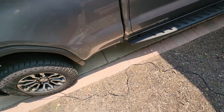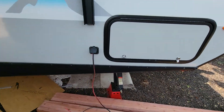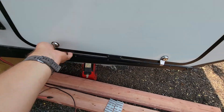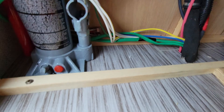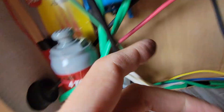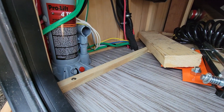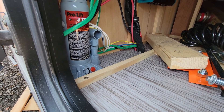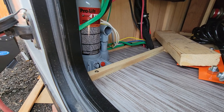You can put the panels on the back of the truck, or maybe the front windshield, or on the roof — whatever works — and then it just connects in over here. On the inside I have 10 AWG wiring with the black and red, and that goes under and into the front, to the battery bank. Before it reaches the batteries it goes through a Victron solar charge controller that I have dedicated just for the supplemental panels.